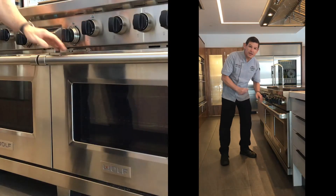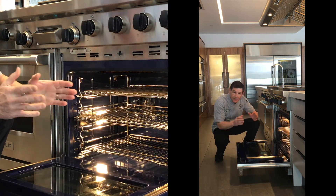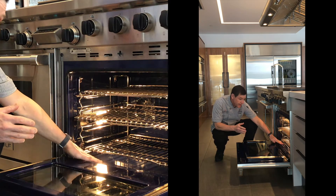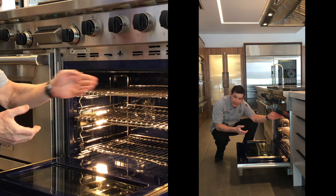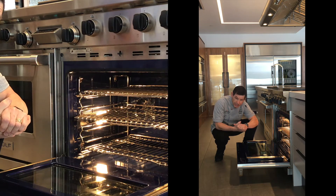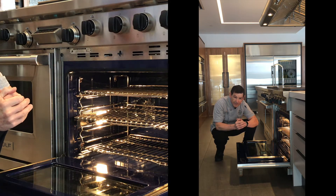Let's have a look inside so we can get a sense of what the oven is all about. This oven has four cooking or heating elements. The lower element, the hidden element below the floor, is our baking element. Above in the ceiling is our broiler element, and then there are two elements around the convection fans in the back of the oven, each one wrapped around the fan to generate heat for our convection system.